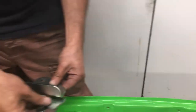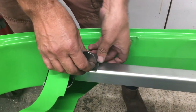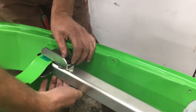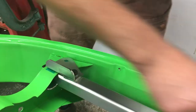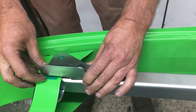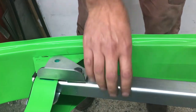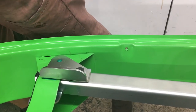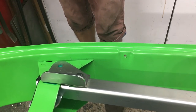Sean's got some boxing brackets and a square plate. The square plate will go on the crossmember, and there's a small triangular-shaped gusset plate that allows the crossmember to have a firm landing on the chassis itself — it's a very strong little bracket, must be fitted. It will tighten down, basically trapping itself on either side of the chassis. We're going to put a hole through the frame and check that everything's parallel.